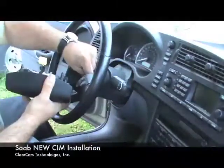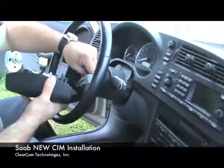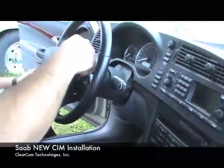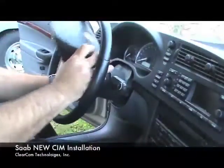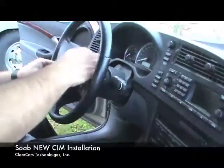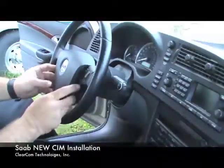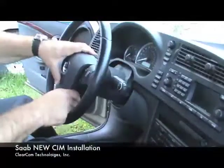I then take and plug the ground onto the blade connector that's on here, and that's on. Then I tip the airbag up so that I can plug in the yellow connector. The airbag is now connected. It's easier, when installing this, to snap the bottom of the airbag in place first.